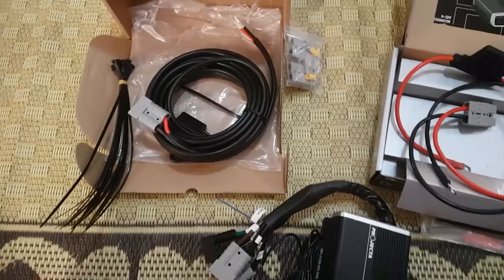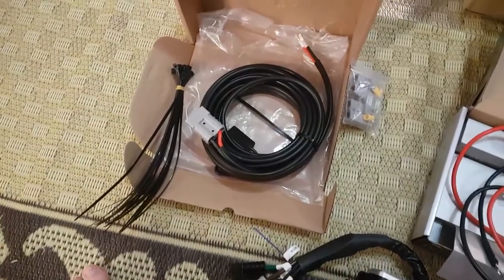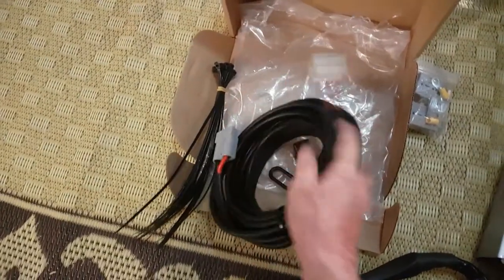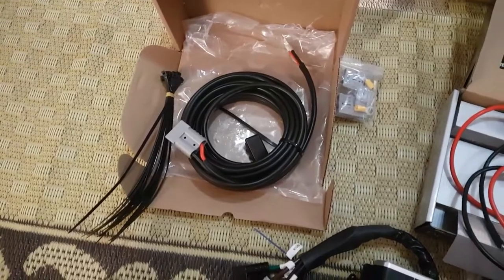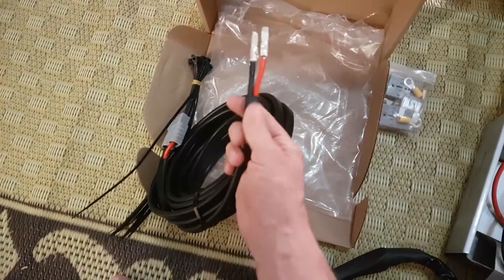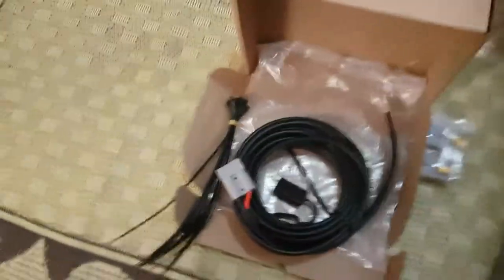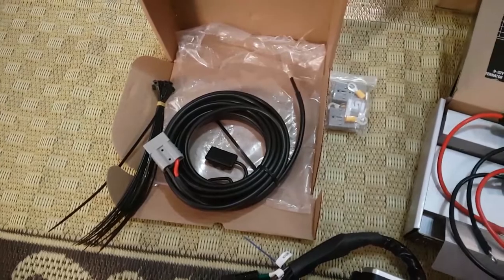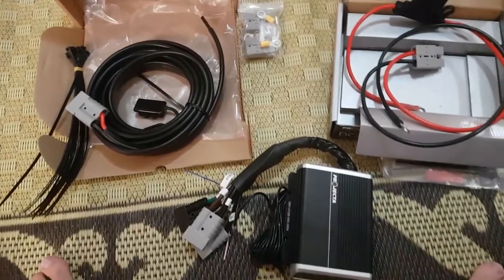This is all 8 B&S so it's nice heavy wire. Obviously if you're going to zip tie it to the chassis that's all right — it is sheathed — but probably a good idea to also run it in some conduit. I'm going to put conduit at the start and the finish where it's exposed. The rest of the line will be inside the chassis rail of the camper trailer, which is already sheathed so that'll be fine. I'll just conduit at the start and finish where it might be hit by rocks and that sort of thing.